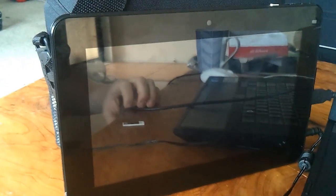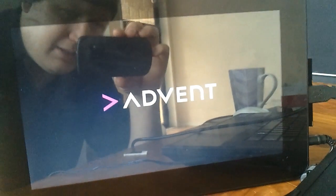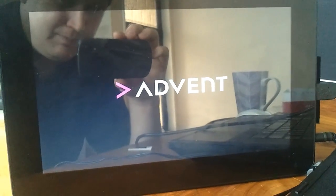So it finished, the DOS prompt finished, and at the end it just comes up and says press enter to continue. Hit enter, and the device will power up for a second and then go back down. So now it should be off, and you should be able to turn it back on. Now it'll look kind of like the original dash, but you're now going from the Viewsonic firmware to the Advent Vega firmware. That'll be the first change you'll probably see, that it now says Advent instead of Viewsonic.